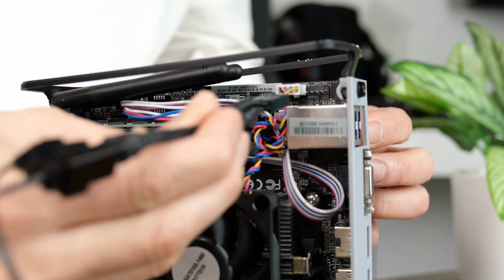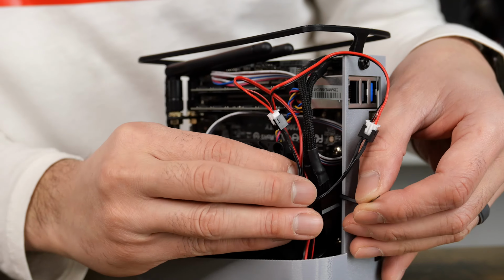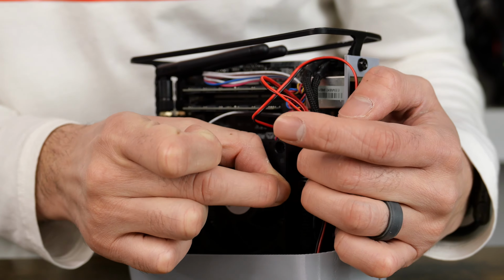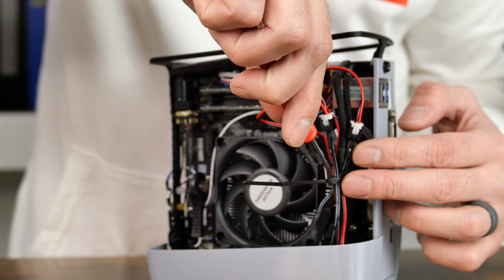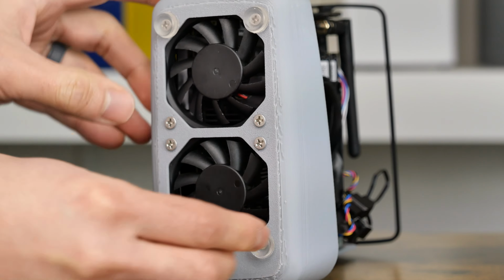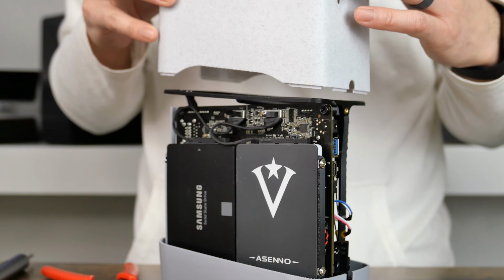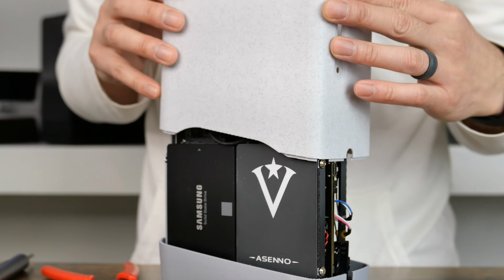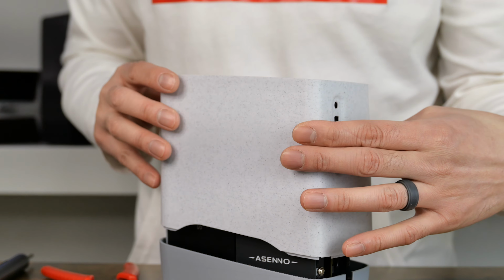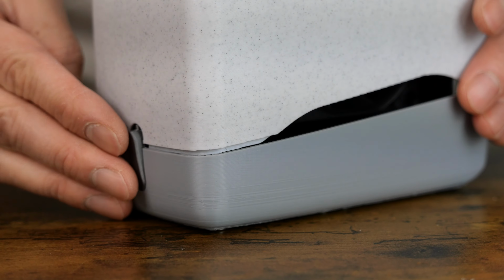I also use a splitter that allows one fan port to control two fans as shown. Here I'm doing a sloppy job of cable management, since this was the first round of testing. I'm glad I did it quickly since the revision didn't turn out. To help give the fan some intake clearance, I used some silicone feet stuck at 4 corners. The middle shell slides over everything, and I make sure to flex it away from the I/O. I then carefully center the button in the case before snapping the shell in place.